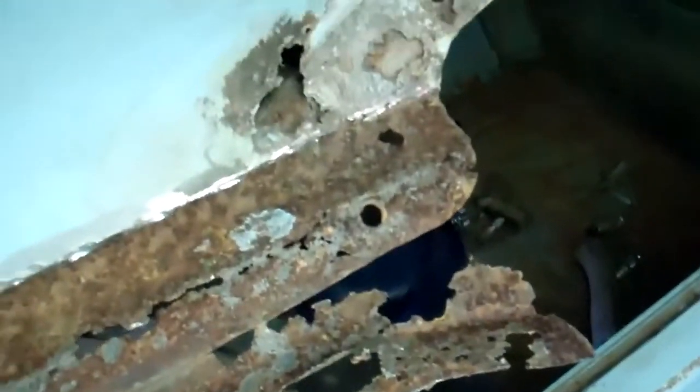So I just had to grind the inside lip over here to finally be able to peel this outside piece off. So there it is. One big bad rusty area of boot lid. And you can sort of see that goes up all the way through on the inside. So there's a fair bit of this boot lid that's going to have to be repaired. It's not just the end lip as I first thought. I'm going to have to go deeper inside there.